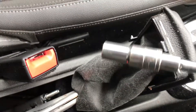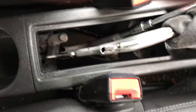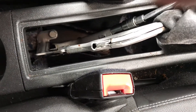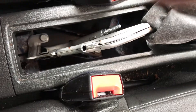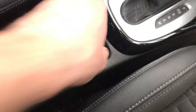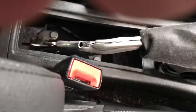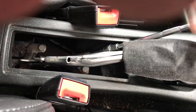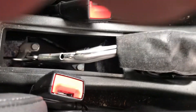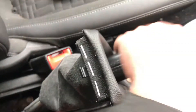I do this with a quarter-inch extension and a long deep socket — you need it because there's a long thread there. Just do it up in little increments, then try the handbrake. It could do with a little bit more. Like so — and that feels a lot better.